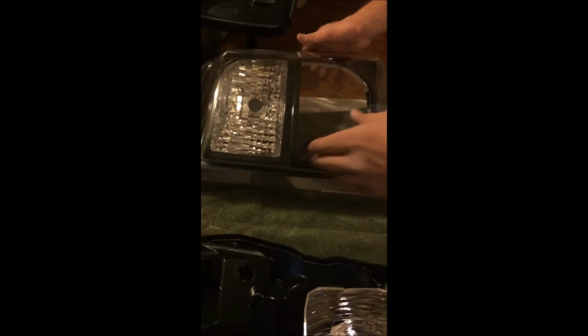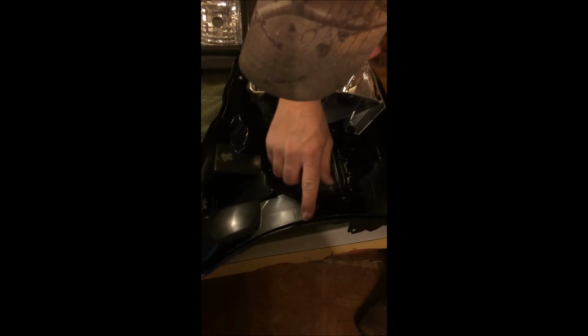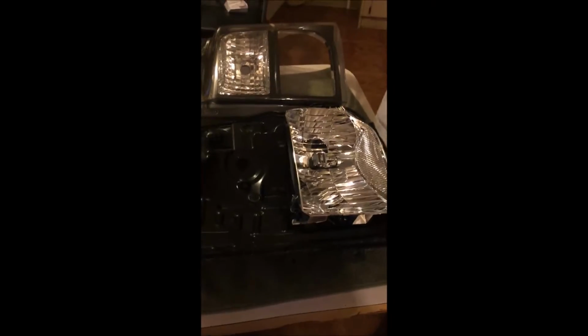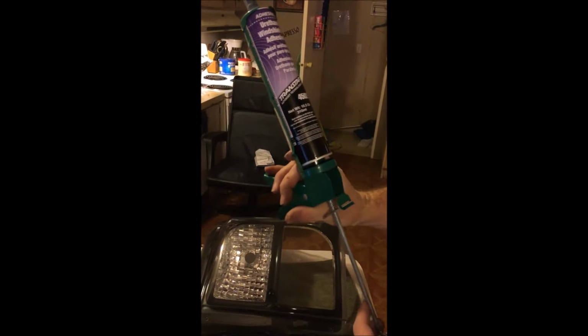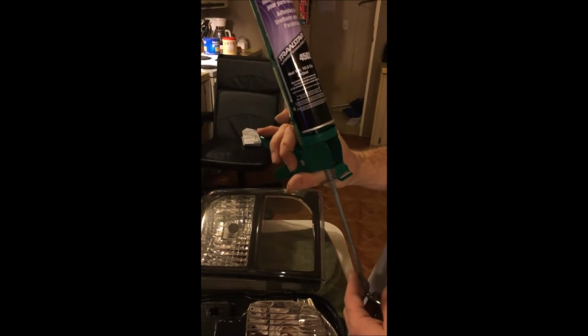Anyhow, I had to go through the track of this one with a heat gun, flathead screwdriver, and clean all the old glue out. I've seen some people don't. I just felt like it's gonna be a better seal. I picked windshield urethane. You can pick this up at O'Reilly's. Once it goes together, more likely it's not coming back apart. So you gotta make sure everything's right before.